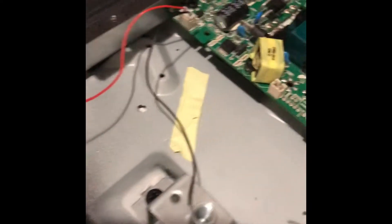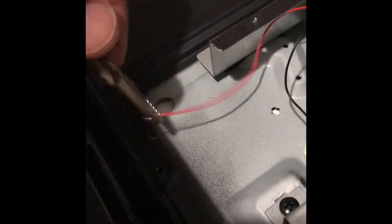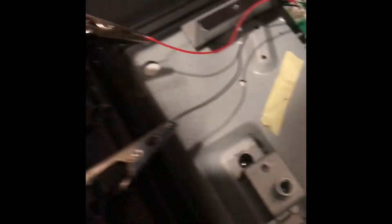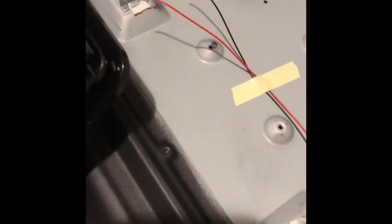What I did was take an old TV with some good LED strips and put jumper wire cables connected to this end. Then I'll connect this red one here — boom, connect that — and then connect this one as well, just like that. So now if I plug this TV up and these light up, I know my output is good and my LEDs are bad.